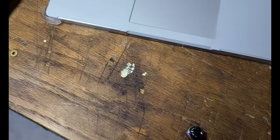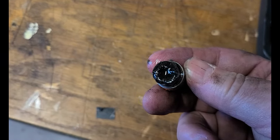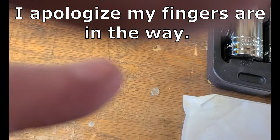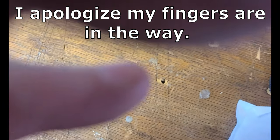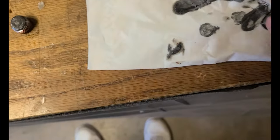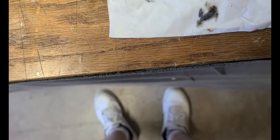Okay, let's take a look and see what's on this drain plug. I'm gonna do this the totally unscientific way. I'm gonna wipe it on this mat here. And, oh, there is a magnet on this. Sweet. So let's take the mat. Here's the magnet. It's so dirty I couldn't tell. That stuff is stuck to the magnet. I don't see any chips though. No chips. I don't feel any chips. But let's see what's in the fluid.